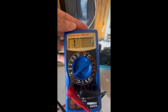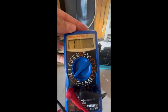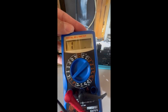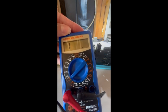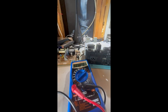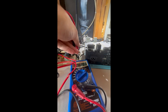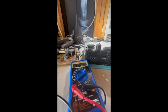While not required, a good idea while you're here already is to pull out a multimeter if you have one, set it to the continuity setting, which is that little wavelength that looks like a sound wave, and we're simply going to attach 1 lead to each side of the fuse, and we just want to hear a beep, just like this. That lets us know that the fuse is still good and in proper working order.